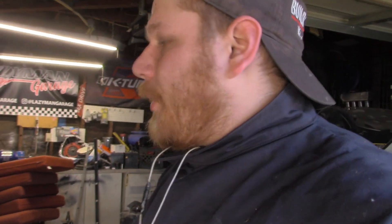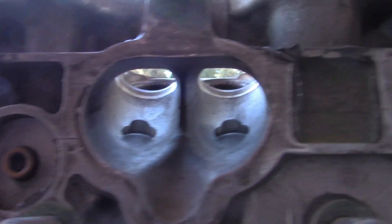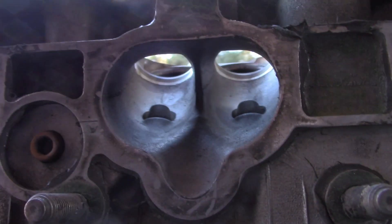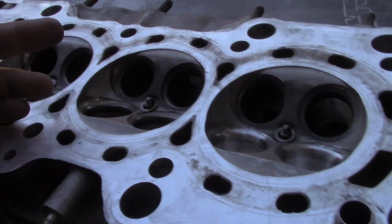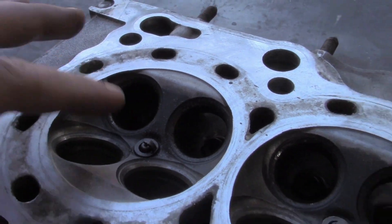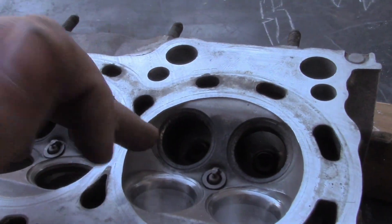So I'm going to fix that head up and revamp it, actually giving the block to a friend — I'll put his Instagram down below. He does all-wheel drive Integra, CRV, EF builds. Right now I'm doing port and polish on this — that's a stock port on an h22a head. I'm comparing mine ported versus stock, and this cylinder here is a lot darker than all the other cylinders.